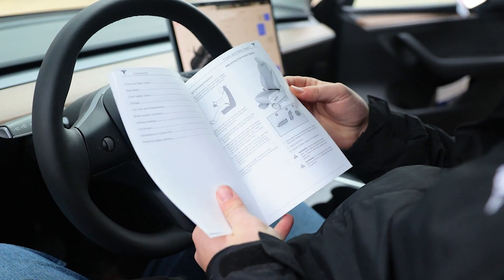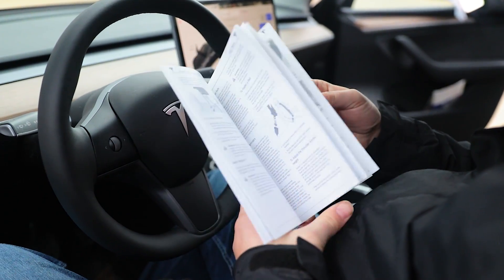Now there have been people that said they have flat-towed their car behind another vehicle if they either ran out of battery or got into a predicament and needed to get their car to a shop or to their house. This can only be done if the owner's manual has an emergency towing mode, so you can put it in neutral. Typically it's going to have to be at a reduced speed for only a certain amount of miles. You do want to check your owner's manual to see if your vehicle can do this in emergency cases only, because if you don't and you try to do it, it's going to void your warranty.